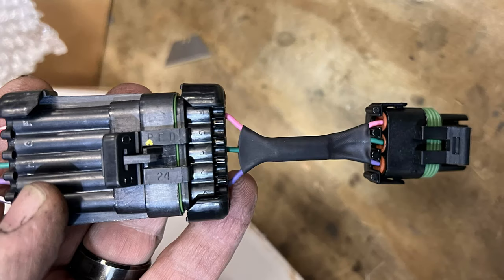I got to get this thing over on Top Dead Center. He has an MSD dual sync distributor for it. We kind of went round and round with Holley with adapters and which one works with this and that. But we got that sorted out today, which I need to make a little adapter wire. They want to sell him one for like $30. And I'm like, Greg, I can put a connector on the end and save you $30 plus shipping and tax.